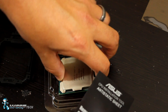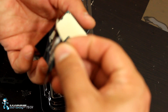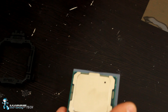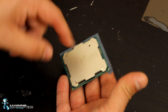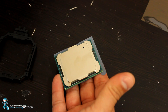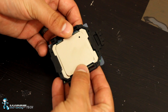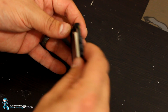Take the processor — you can do this while it's still sitting in the package. There you go, you've covered the bottom of the processor, it's protected. We're going to clean this before we put a heat sink on it; we're just doing this for demonstration purposes. Now that we've got it on here, you've got the arrow with the tab lined up, and you'll clip it down so it's actually holding the processor. The processor is now completely held by that.